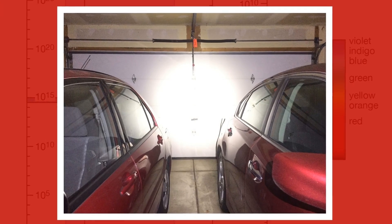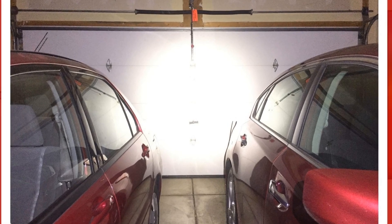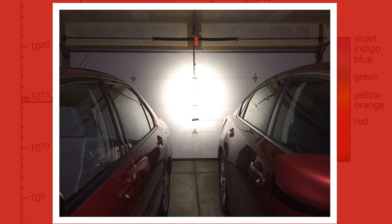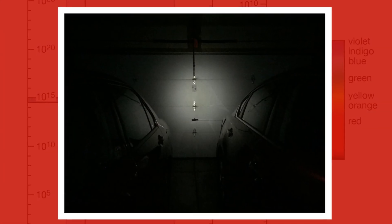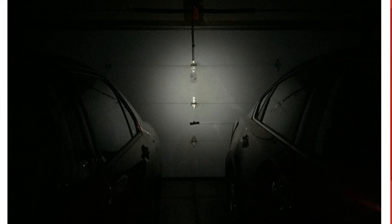I'm 15 feet away from the garage door. At the highest setting — 2,000 lumens — expect about 30 minutes of use with the thermal throttling. It has a 200-meter throw. At 1,000 lumens, expect about an hour and a half runtime. In muggle mode at 240 lumens, that runs about 9 hours. Around 100 lumens runs about 20 hours on a 3,000 milliamp-hour battery. At 5 lumens — the bottom of muggle mode — expect about 115 hours. Very nice.